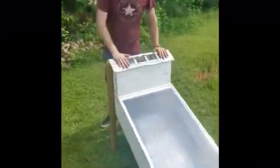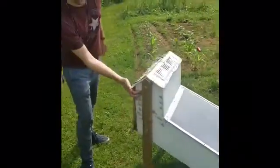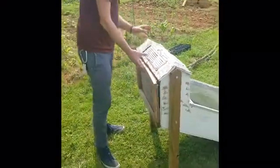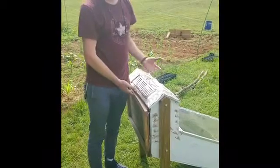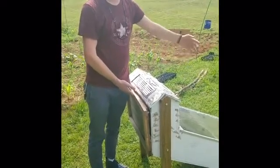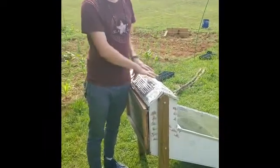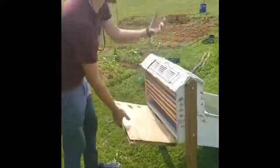This is the thermal chimney, and I actually have it where this unhooks right here. These are vents in the top, so as the heat comes in it has a place to ventilate back out. It pulls in cool air, heats it, and dumps it back out because it's going to collect moisture from drying the food. It pulls that moisture out and has a place to vent it.